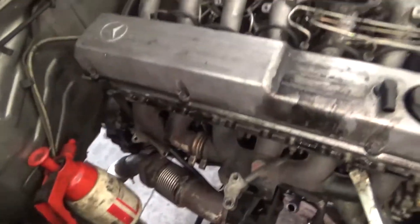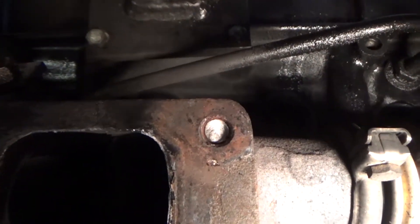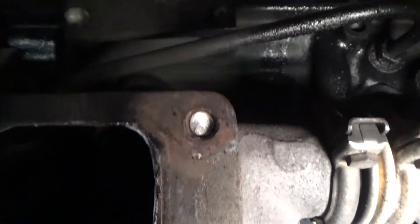The original Mercedes five-speeds don't handle as much power, so we'll see how that works. Stay tuned. We've gotten the turbo out and the intercooler piping is on its way, but we managed to break one bolt inside the flange, so now we have to weld a nut to it to get it out. Hopefully we get it out — if not, we'll have to run three bolts for a while.